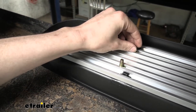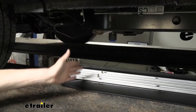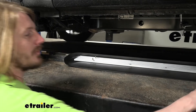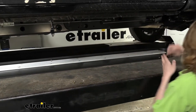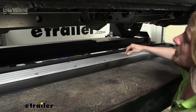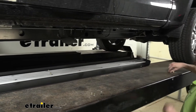I set the running board underneath the truck and push the bolts down until they roughly line up with my bracket, then repeat the same thing with the remaining two. For the bracket furthest in, you'll have to start from one end and push it all the way down. The bolts are still going to be loose and will move when you go to lift it up, but the closer they are to aligned, the easier time you'll have when you go to lift it into place.